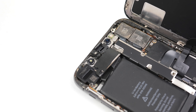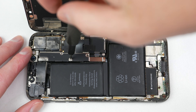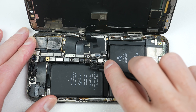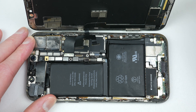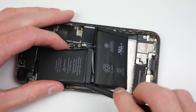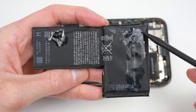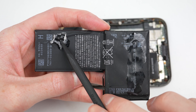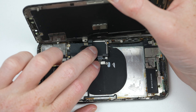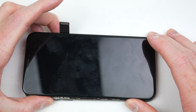It's amazing how good the phone looks from the outside — it fooled me. I'll continue disassembling and removing the necessary parts for the template. Because I know people will ask, I'm going to attach a working battery and see if that changes anything. The original battery was held in not with Apple's stretch adhesive but with superglue — a really poor choice. With a new battery attached, it's no surprise to see that it still doesn't turn on.